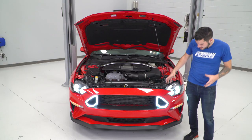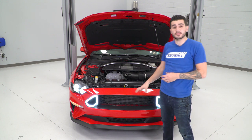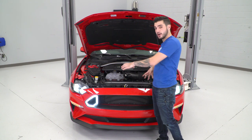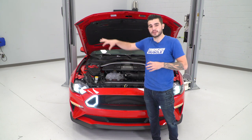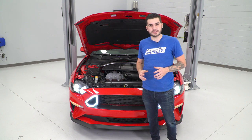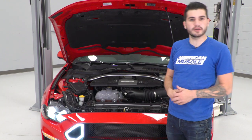Now that we've tested our lights and confirmed they work, we still have a couple of things left to finish the installation. We need to bolt up the top radiator shroud, make sure everything's squared away under the hood, bolt up those stud blocks connecting the fender to the bumper in the wheel wells, and finish with the belly pan. Let's do the radiator shroud first — it just lays back down in place and you line up the holes where your plastic rivets will go, push into place, and push down the top plunger. Do that across the entire shroud.